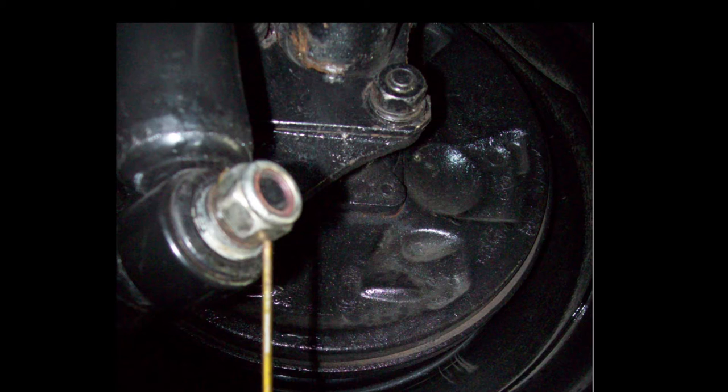My 65 Beetle was exactly one inch out. Why was this car one inch out? Either it's been bumped slightly in the front or the rear, or maybe it's just stacked tolerances, which means all the tolerances add up to a difference. When I found out the car was one inch out of square, the next obvious thing to do was to check for any kind of damage - anything I could see bent as far as the axle tubes or the torsion bars - and I saw nothing.